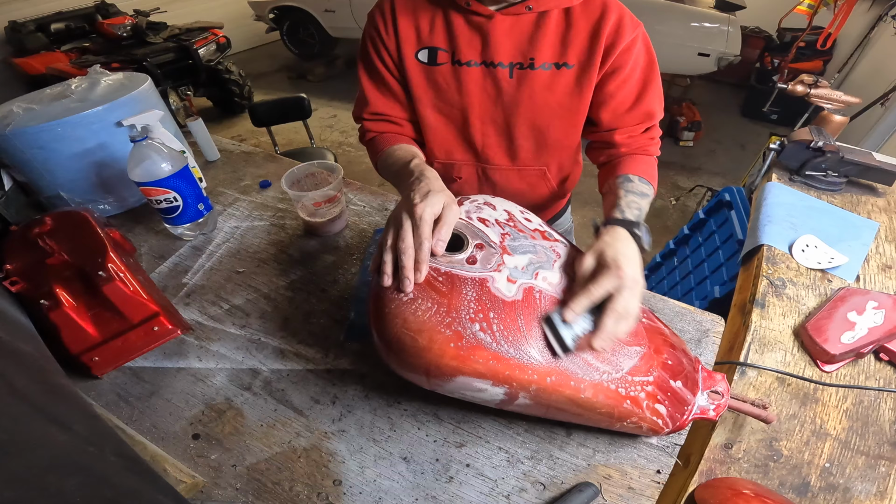So the parts of the Shadow, a little bit of a closer look. Clear coat really just coming all apart, so I'm gonna have to take it right down to primer. That's the original color since I painted it, because this has like a bracket over it, so this hasn't seen sun. That's what it should look like, and that's what it does look like. So gonna have to sand through, scrape off that decal.